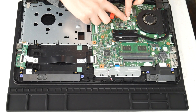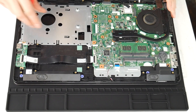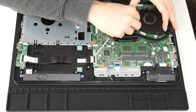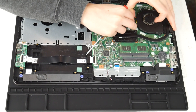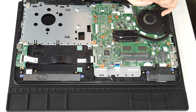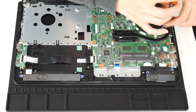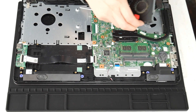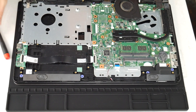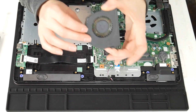Next I'm going to show you how to clean your fan. This is another big reason why people have issues with their computer overheating. I'm going to unplug it and then take the two screws and undo it. So I've examined my whole board, cleaned any sort of spills or liquid off of it. Now I'm taking the fan off. I'm going to take a high pressure air cannon — you could also use a hair blow dryer or a can of compressed air. I've included the can of compressed air and the air cannon down below.